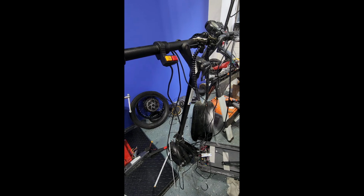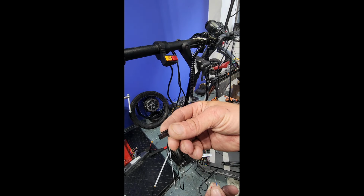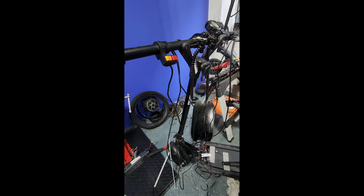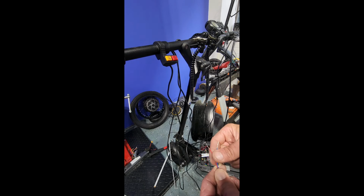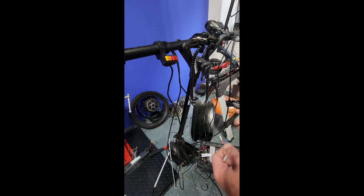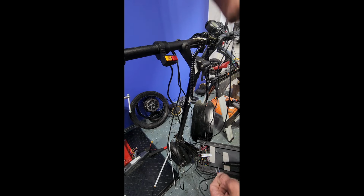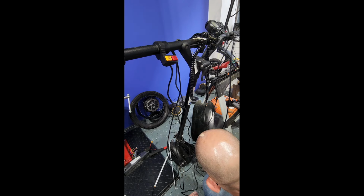And now I talked to you about how to de-pin the connector. All right, so now we're going to reinsert the new wires into the connector. And what you want to do, now this is very important. Well, can be. Since this sensor just closes a circuit, it's not imperative that you have the wires corresponding on the same side as the female connection, but I always like to, just to maintain uniformity. So I'm going to consult the connector down here.